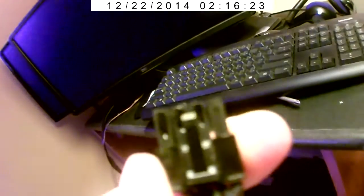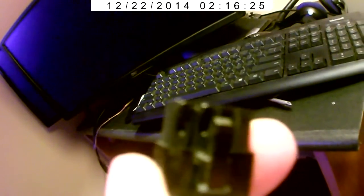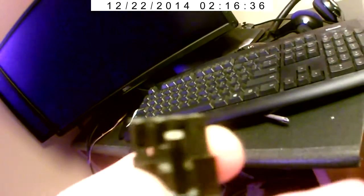I show how my power supply shorted out, and the cause of it was this 8-pin power connector melting 3 of the power pins. The 4 on the inside are power, the 4 on the outside are ground. Originally I thought that it was because the radiator was pinning up against the wires and the heat from the radiator caused it. Well, that was a misdiagnosis. The actual cause was a combination of the MOSFET heatsink, lack of airflow, and power draw from the CPU because it was extremely overclocked at the time.